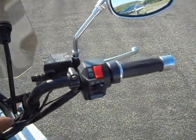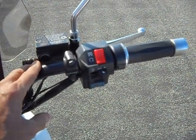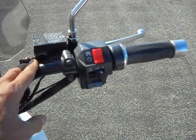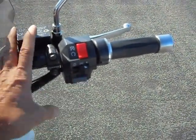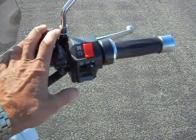All ZEV use a 3-speed electronic transmission. This allows us to vary both the volts and the amps in a controller, so we can radically reduce the amount of power that it takes for the bike to run down the road. If we select second gear, the bike will run a maximum speed of 48 miles an hour in that gear. If you want to run faster, you can run in third gear.